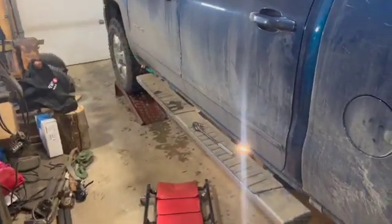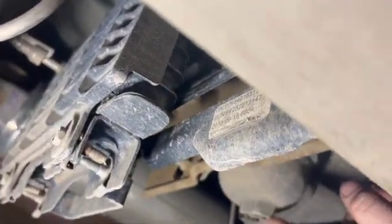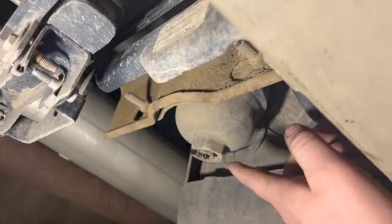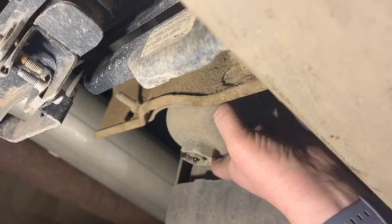So we'll put the truck up on some ramps on the front just to make it a little easier to climb in. And if you go under here, basically under your passenger side door, or rear front driver's side door, pardon me, and slide underneath, there is your fuel filter pot. Now it's an 18 mil wrench to loosen off your water separator, and that starts letting it drain out. And it's about 1 7/16 inches, I think. And that will unscrew your entire fuel filter pot, and it'll come down and it'll drop out the element.